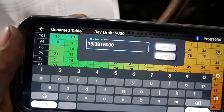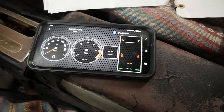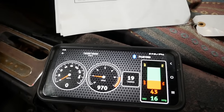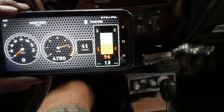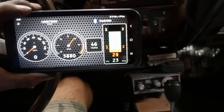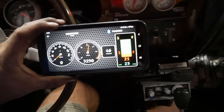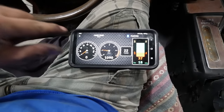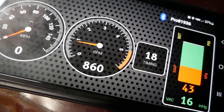I'll name it '16i 38t 5000' — 16 initial, 38 total, 5,000 RPM rev limiter. It has a gauges screen where you can actually see the timing live. Wow — what a throttle response! I need to play with the curb idle after messing with it — it's sitting up too high. Obviously I'm going to have to play with this by driving it around, but I can already tell it runs better. I'm probably going to buy one of these for everything I own.